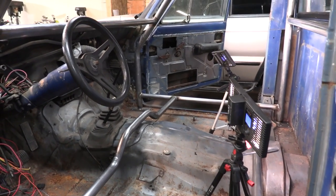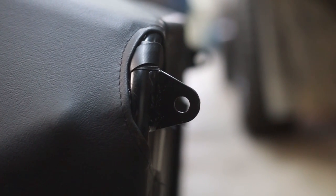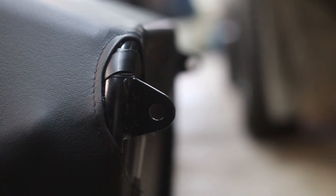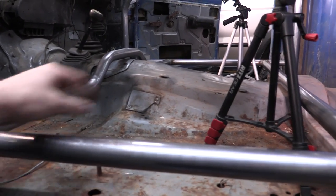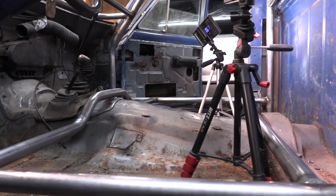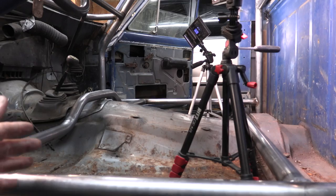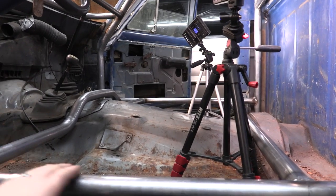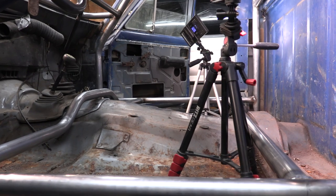I want to make sure that things look and feel professional - at least as professional as I can produce - and to me this is one of those details that's worth the time. Now we're going to mount the seats. I've got some ideas of how to do this. There are some little loops on the bottom of the seats and I think I'm just going to use some flat bar going from front to back, drill some holes. I'm not going to put these on any sliding brackets because I'm going to push them both all the way back - that'll fit me great on the driver's seat. I'm not worried about anybody else driving it, just me.